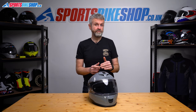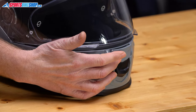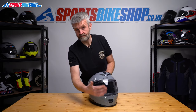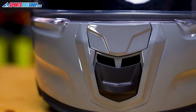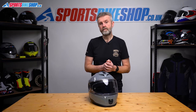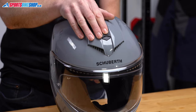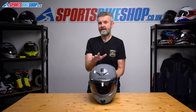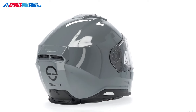The ventilation comes through three inlets on this helmet and it's excellent. The rocking vent closure just under the centre of the visor directs air through to the eye port, and the sliding switch underneath it brings air through to the mouth, which is filtered by a mesh insert that can be taken out to clean it or replace it. The top vent has three stages: closed, open, or half open. This draws air in, which can then circulate through channels in the EPS impact liner and exit at the back